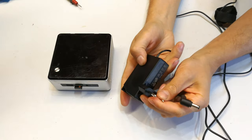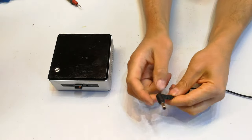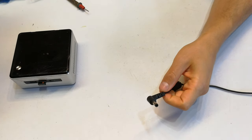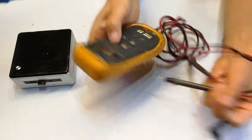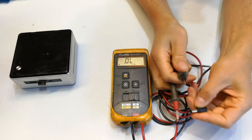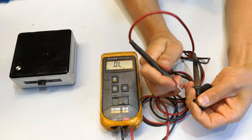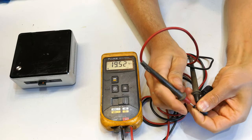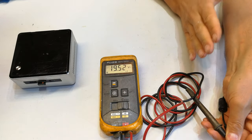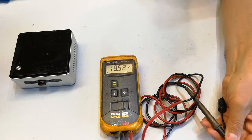This must be plugged in, so I'm going to plug it in now. With it plugged in, there should be 19 volts sitting here. Take a multimeter, set it to volts — the outside is earth and the inside is positive. There you can see I've got 19 volts. So immediately I can tell it's not the power cord and not the AC adapter — that part is all working.